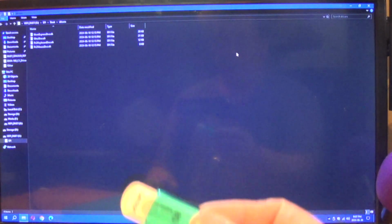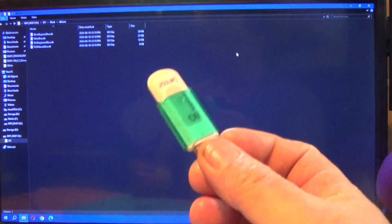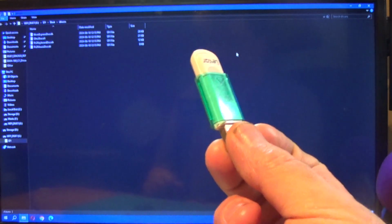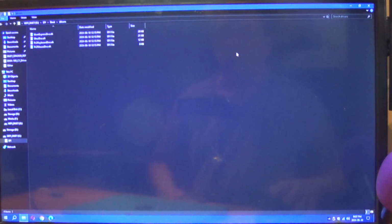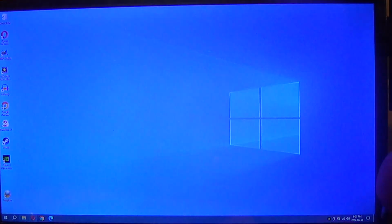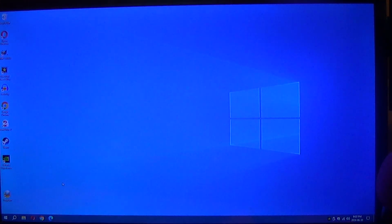Windows Install can see the NVMe drive because there's drivers in your install. However, there are no native drivers in your laptop at the moment. So once you are done with your install, there's no way to see into the NVMe drive unless you have these drivers in their proper place on the thumb drive. This really surprised me. I didn't know.